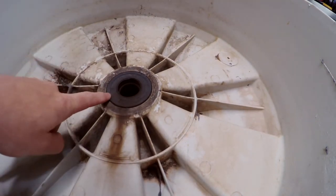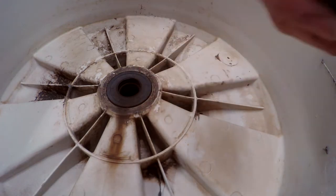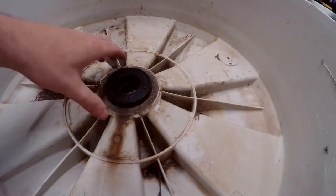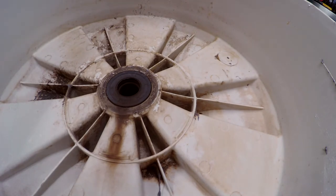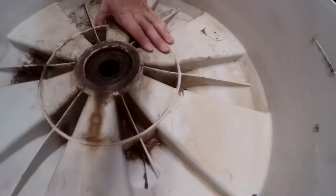As you saw, there are two bearings and a seal. Right there is a little spring — you don't want that coming off, so make sure it's on there. First thing you want to check is that it fits right, the right size — that's looking all right. I'll take that back out now, take off the wedding ring because these things are gonna get nasty. I'm just gonna use a frame and hammer, but you could use whatever you like.